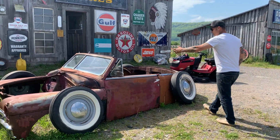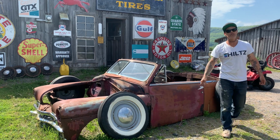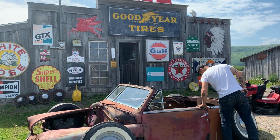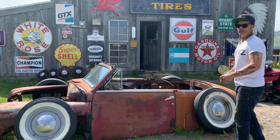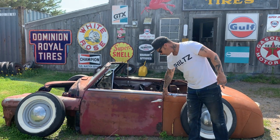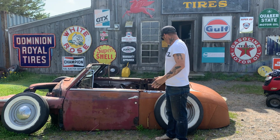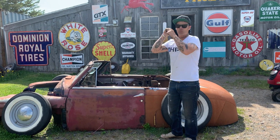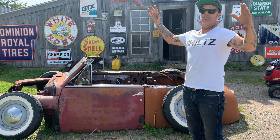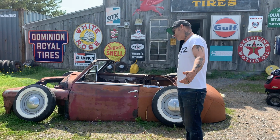And the best way, in all honesty, is to have all that floor gone, because that floor needs to be gone anyways, because you're going to be running a drive shaft. If you know what I'm saying. All the cars, this one's braced up fairly good, because we had it sitting on a chassis. But generally, the cars that I do, I cut corners, and this is what I do: I weld the doors onto the quarter panel. And that way the car can't go like this. It can go back and forth a little bit, but if it's connected to the back, it doesn't go back and forth. I always weld the doors together on the cars when I do it. It's just faster than cutting all this pipe up to make sure it doesn't distort on the inside. If the doors fit, it's right. If the doors don't fit, it's not right. And that's what I generally do.